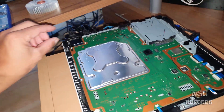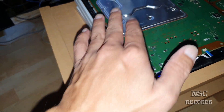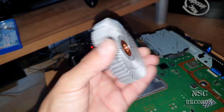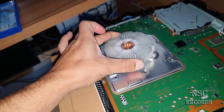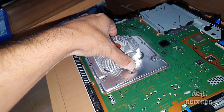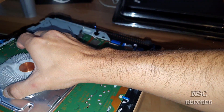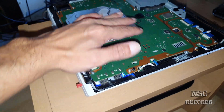I have also just put some feet under the case - I'm going to show you this later. When I now just close the case back, the air which can escape from the side a little bit is going to help you cool this part here, because this part gets really hot. I got here an old Intel cooler - this is from a socket 775 computer. I put it here inside for a while, and then turned it to this side because I got more space there. After 10 minutes this area was also getting very hot, which is a sign that this part really gets hot because the VRAM chips are sitting there.